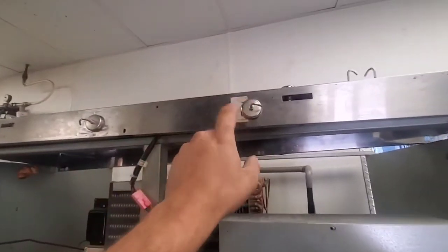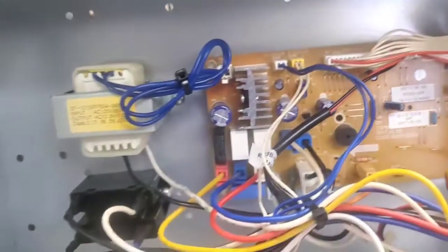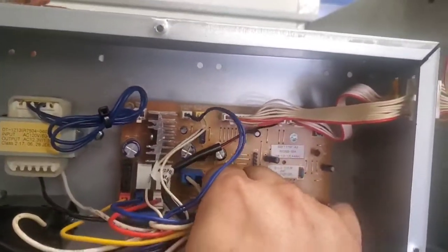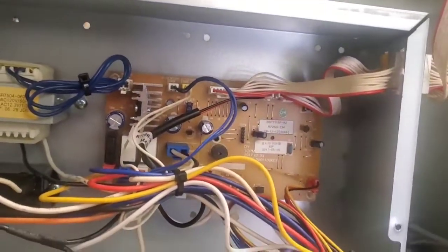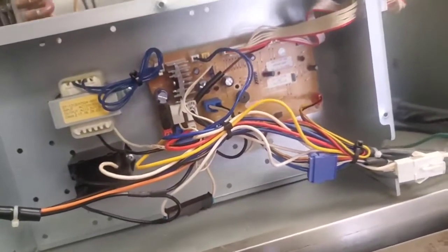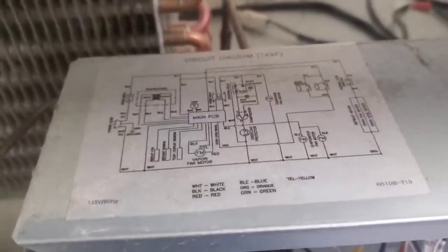Here's what we have to do to defrost this one. Take this cover off. Stick magnets on the door switches. Open up this electrical box to reveal literally the cheapest made control board in the industry, right here. I'm going to unplug the transformer and plug it back in. Did you hear that? A goofy little sound effect. They're also the only people in the industry that did that. And forget all about this wiring diagram — it doesn't reflect the actual wiring.